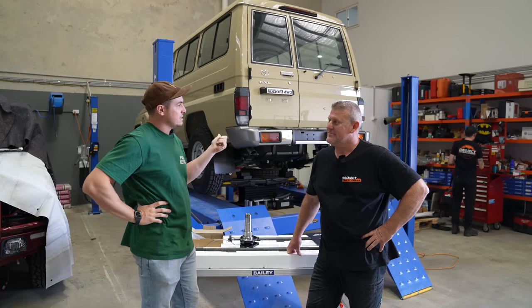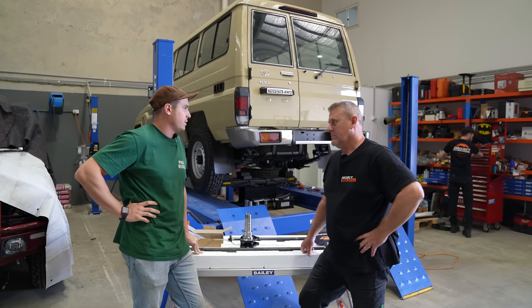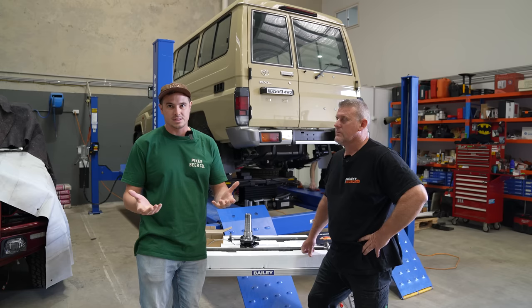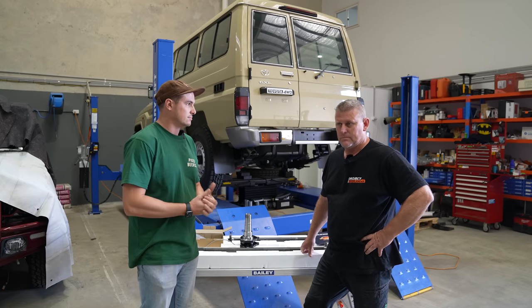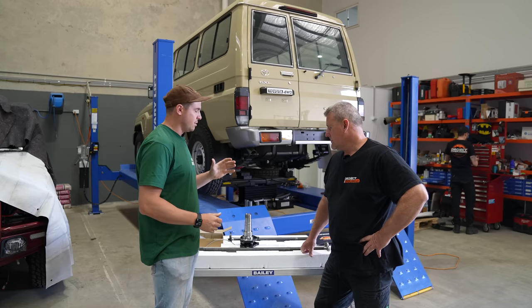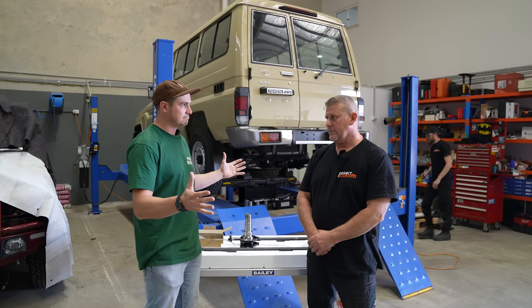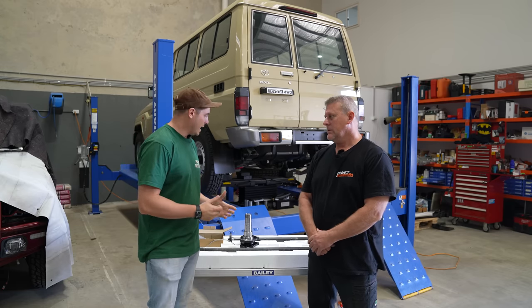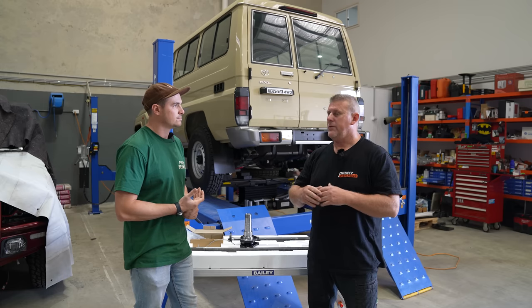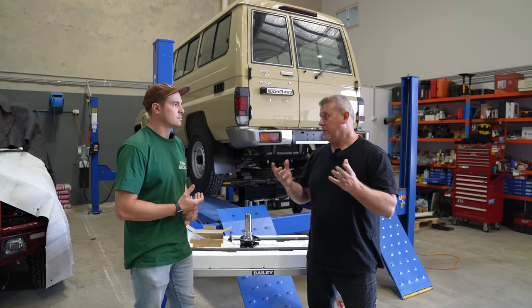Alright Steve, so the Troopy is behind me now, getting work done on it as we speak. One side has already been done with the track correction — we've got the Multidrive True Tracker correction. So before we run through and explain how it works and all the bits and pieces that go with it and why... The thing to note about this is it is not a diff replacement. It's essentially a diff extension — a widening. Which is also compatible with a GVM upgrade, to a certain point. And then if you want to go for the really high GVM upgrades, that's when you really look at doing the diff replacement system.